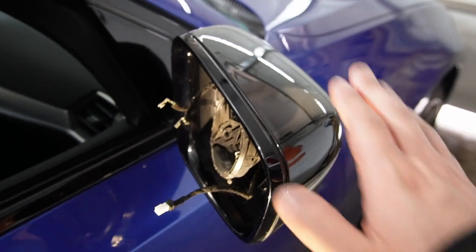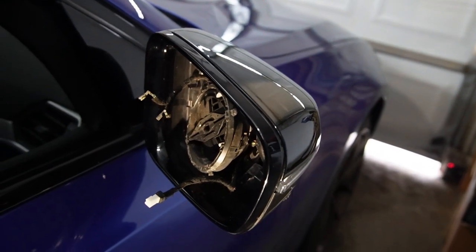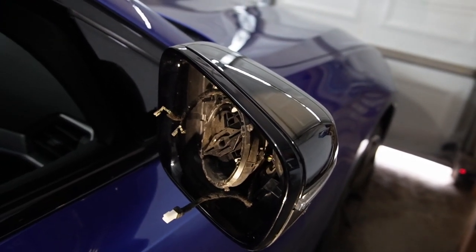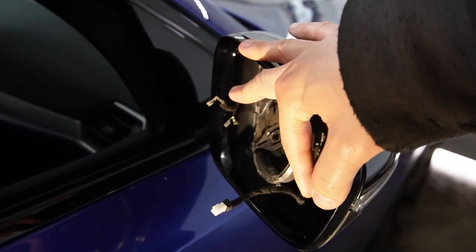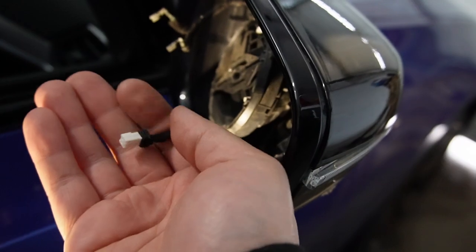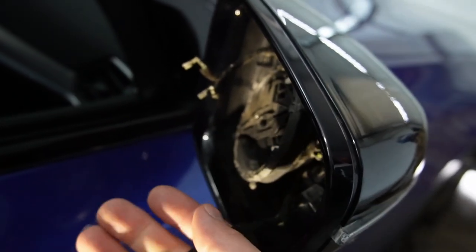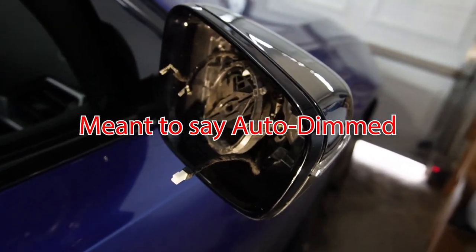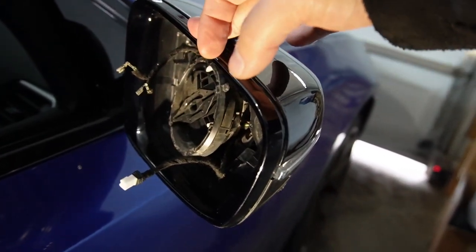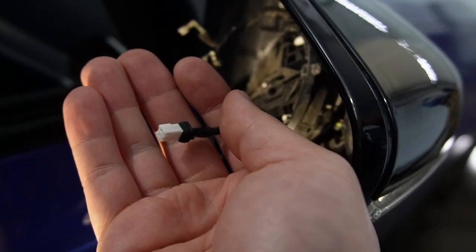Now I'm working on the passenger side — driver's side is all done. The mirror currently has three wiring connections and a snap ring holding the mirror in place. You'll have to remove all three wire connections. I wasn't sure how to remove the lane assist warning connector because it's completely different. The other two are just your regular heated mirror connections — there isn't auto-dip on the passenger side, only on the driver's side.